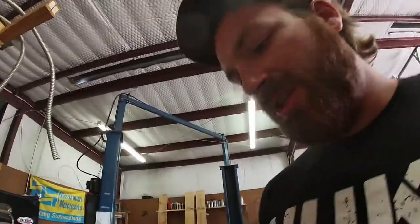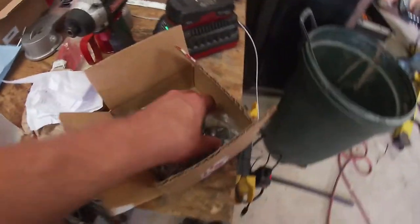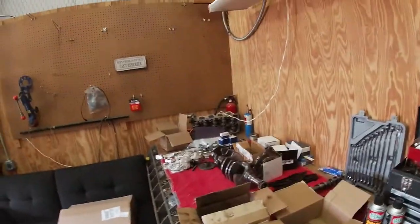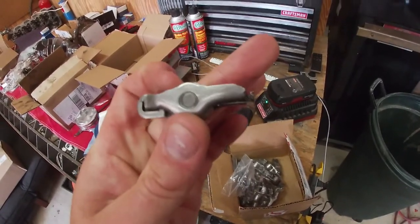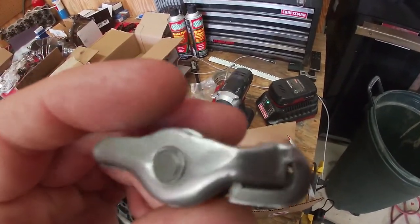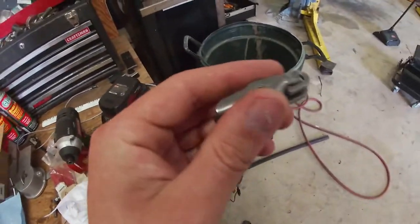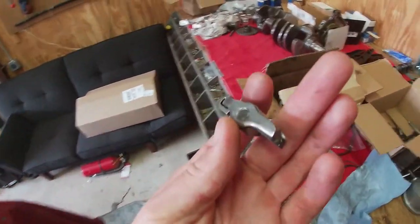This should be my last box — the third last box I've been talking about. These are the rocker arms to make the GT cams fit in the Shelby heads. I was a little suspicious of the rocker arms because they don't look like much and only have a little tiny groove taken out of them. When I put the other rockers in they didn't fit, but I'm actually pretty sure these are just the regular GT rocker arms that are clearanced.